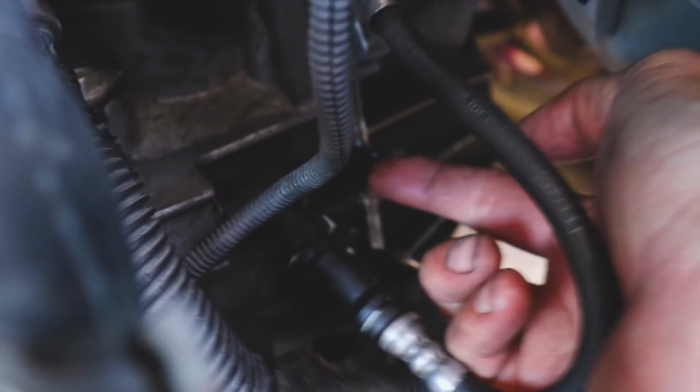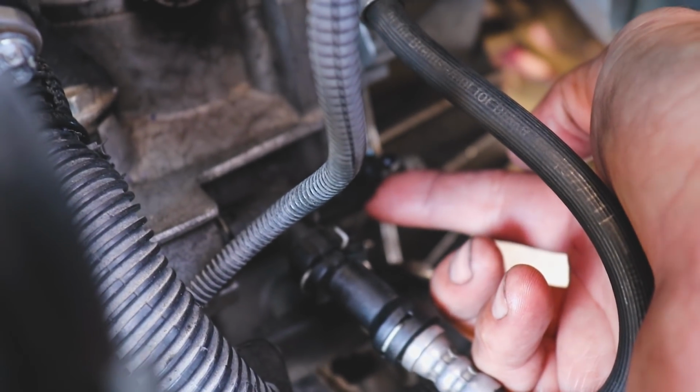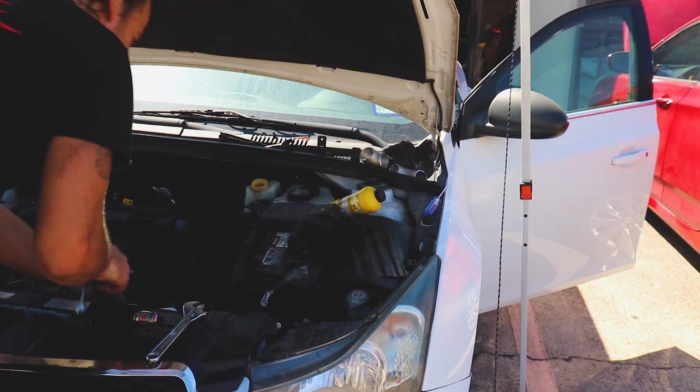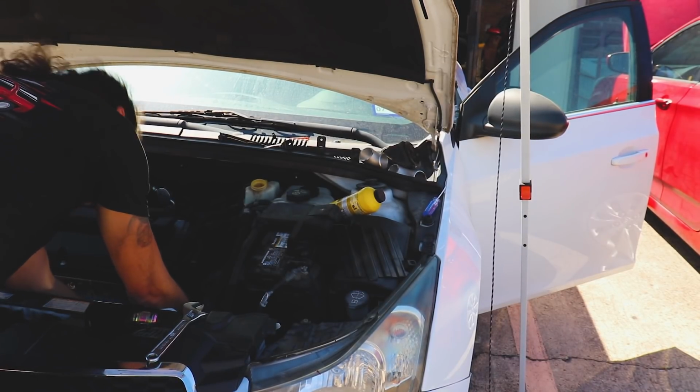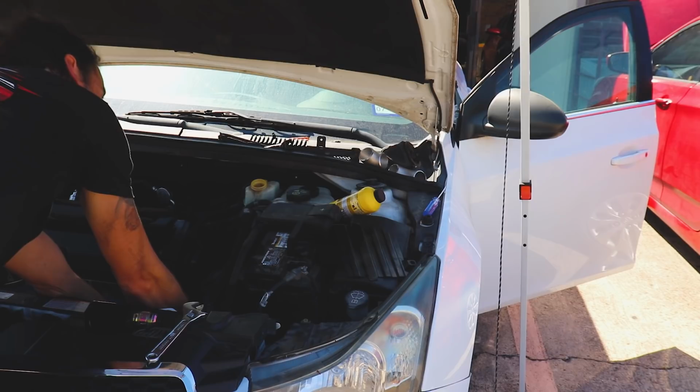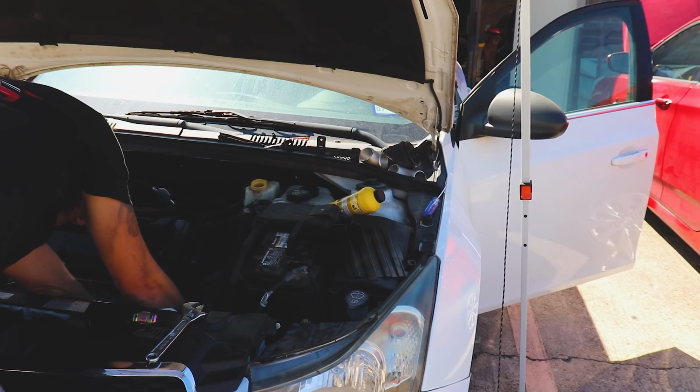Topping the fluid off. And right down here, this tiny little valve where we gotta have her pump it, hold it to the floor, open it up, crack it. Okay, go ahead and pump it 3 times. All right, hold it. Heard. All right, pump it. Hold it to the floor. Oh man, that stuff's black.